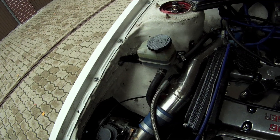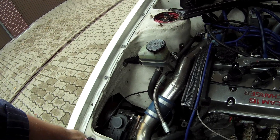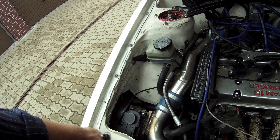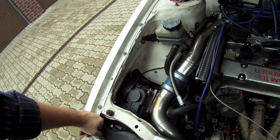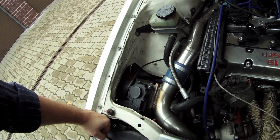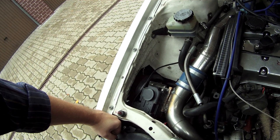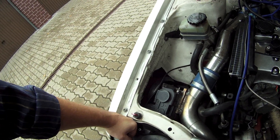In the previous version of the system, the switchover moment when the supercharger disengaged was noticeable but not that much. With this bypass valve, it's even better. Even though we're opening the valve at strict RPMs, the moment of switchover — when we stop using the supercharger and the turbo starts sucking through this hole — you actually don't feel it at all. You can see a small spike on the boost pressure gauge, but sitting behind the wheel you feel nothing.